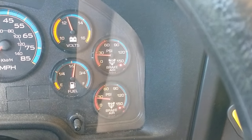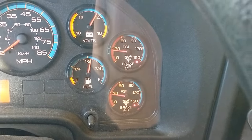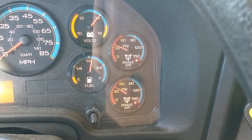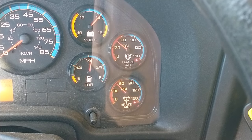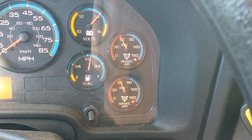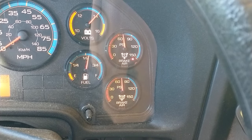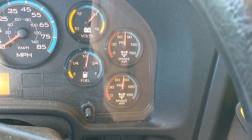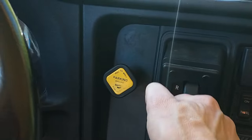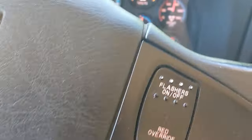I'm going to build the pressure back up. Now that the pressure is built back up, I'm going to test the parking brake to see that it holds. I'm going to put the bus in drive and accelerate — the bus should not move. The parking brake is holding.